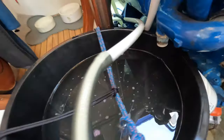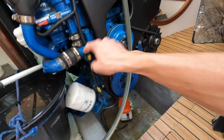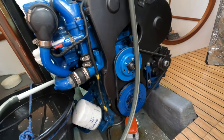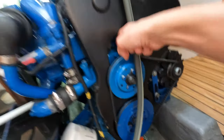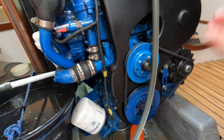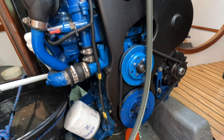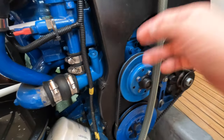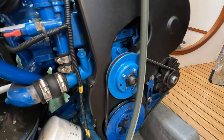I'm going to do this a couple more times, and then I've got to start taking off all of the pulley assembly to get access to the water pump. This is the water pump behind here, driven by this pulley. So I've got to take off the timing belt case, the timing belt, and the pulleys inside here — strip the front end of this engine off. Once I take that off I can see inside the block and hopefully the water jacket will look a lot cleaner than in our prior video. I'll then be able to flush it with the hose pipe through the big hole.